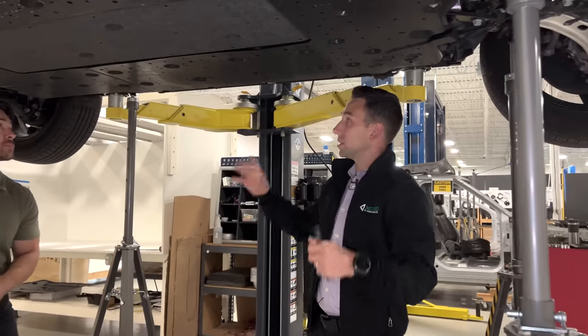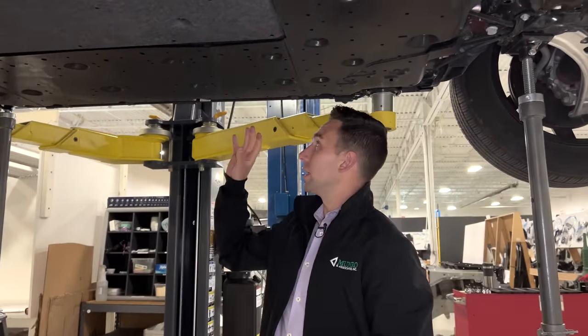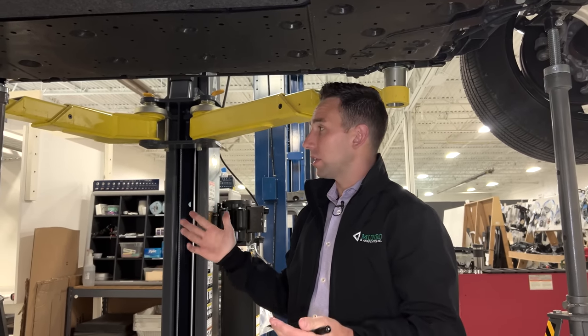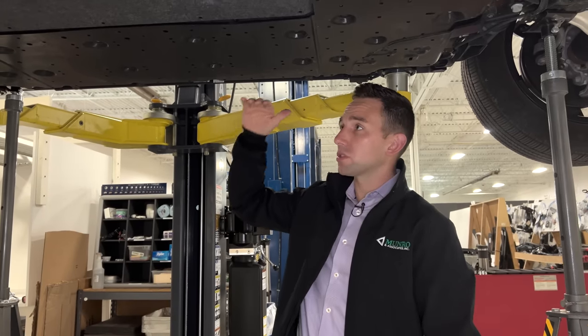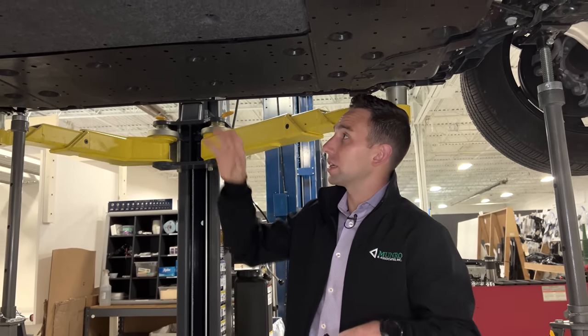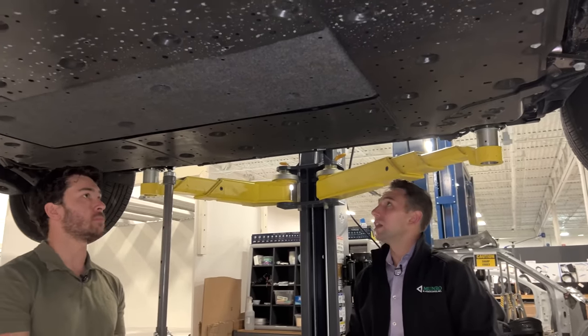So, yeah, I think for me, when I'm looking at the underside of the battery pack, you know, Julian, as you kind of articulated, the whole thermal management strategy is a paradigm shift, at least from a perspective of how you look at thermal management. You know, most folks try and close everything out that they possibly can, but the Swiss cheese effect that we're getting here, they're leveraging kind of that Venturi effect, if you will.